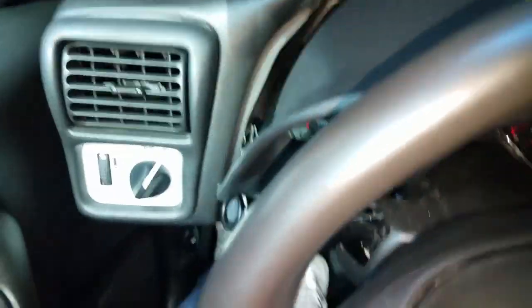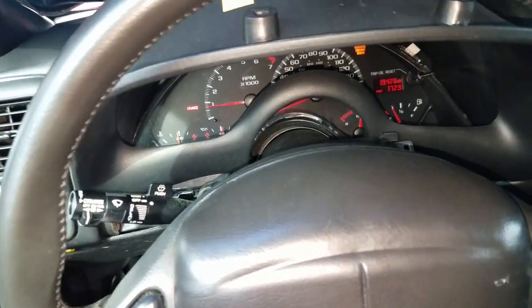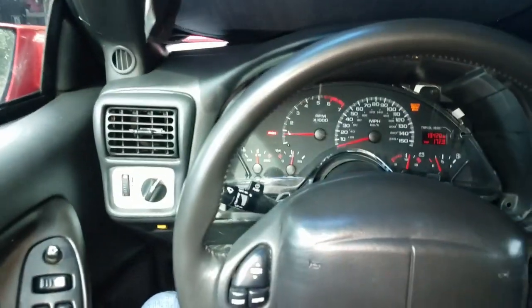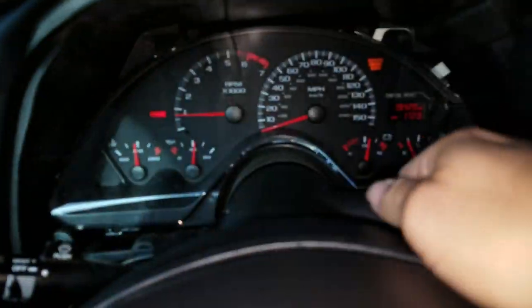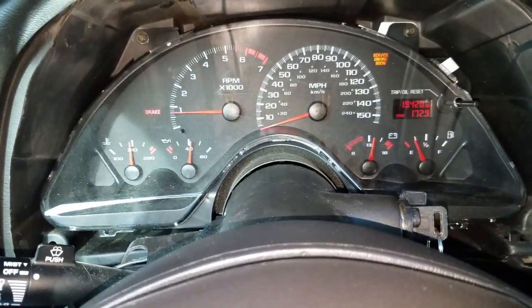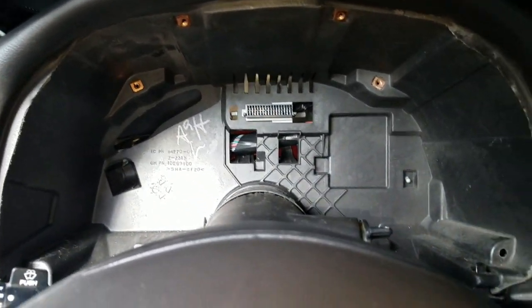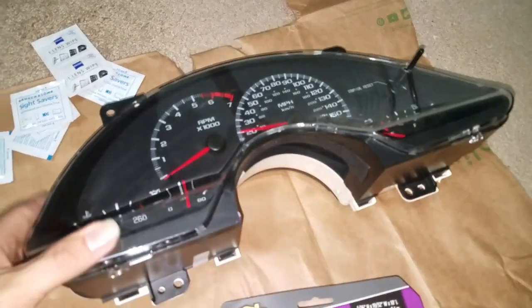To get this little bezel around here out, you also have to remove a little plastic piece on the other side of the turn signal — you're gonna want to pop that off, otherwise you're gonna have a hard time. Bring it up and out to your left and just around so that way you can get it out. Then remove those bolts in there and it should just slide right forward. Taking the gauge cluster out was a pain — it was getting caught up here and there. It wasn't the easiest thing, but it's out.